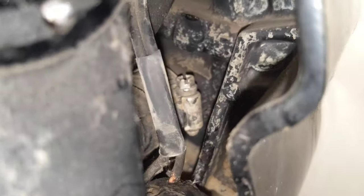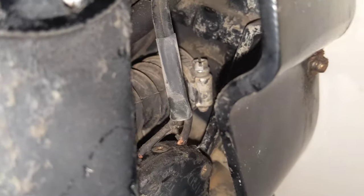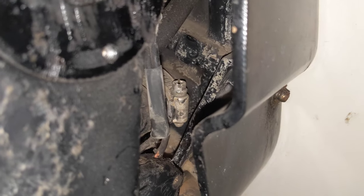On the starboard side of the boat, that hose clamp right there is the shift bellows. I'm going to get in there with this ratchet — I might need a swivel adapter and extensions, but I'll try this for now. The shift bellows hose clamp came off pretty easy. All I used for the inside was an 18-inch 3/8 extension with a 3/8 swivel and an 8mm socket, which is basically a 5/16.